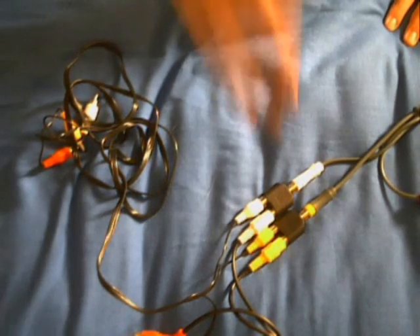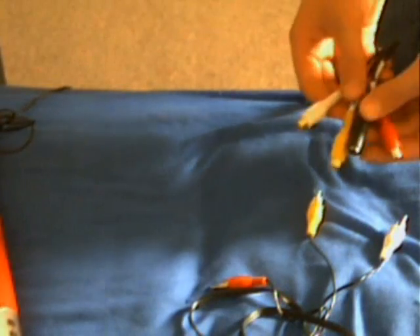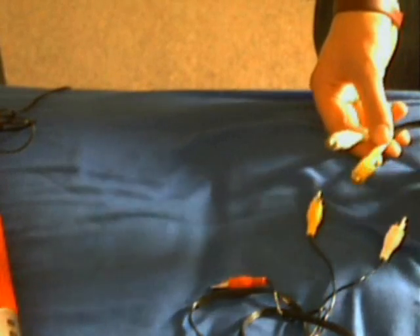So now we have one composite cable with its white and yellow plugged into the splitters, and the other composite cable with its white and yellow plugged into the splitters. With one of the composite cables, get the other end and plug it into your TV — so from the splitters, it goes all the way around and up into the TV. The other composite cable has spare ends, so plug those into the EasyCap: get the white and yellow ones, yellow into yellow and white into white. Don't bother with the red and black ones on the EasyCap.